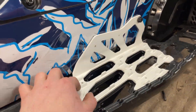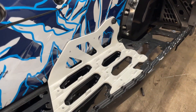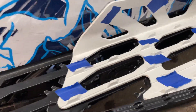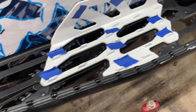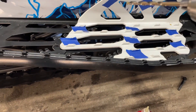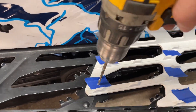Now I'm going to tape off all these holes and drill them out with a 3/16ths bit, then rivet it on — even this side, even though it's not cracked. There's a big gap down here — that's how much those boards are bent. I'll tape the holes so the drill bit has a buffer and won't scratch the surface. Add a little bit of lube to your drill and drill away. The reason we're doing it this way is that bolt keeps everything in line, and I'll put the rivets in as I go. No turning back.